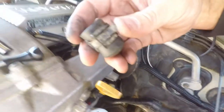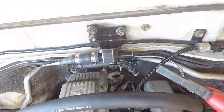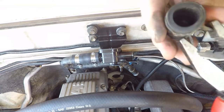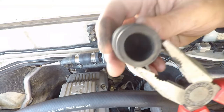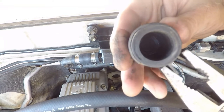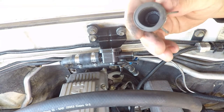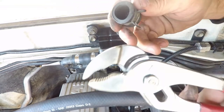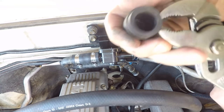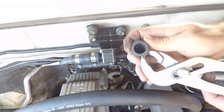So I'm just going to put the plug on that end here using one of these constant-tension spring clamps. These can be pretty tricky to get on and off. When you're battling with these things, you're probably going to grab your combination pliers — but see how they're not in line? They just slip off. Let me show you something that's a truckload easier: just get your adjustable pliers. Look at that — easy.